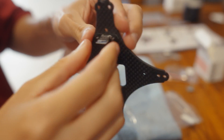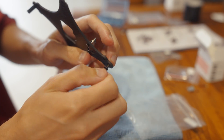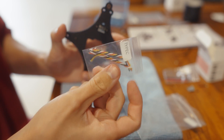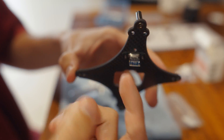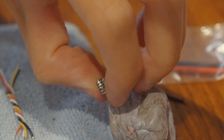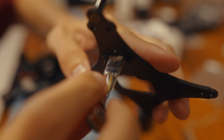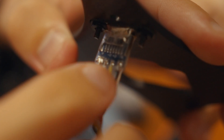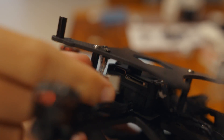Now the final plate - put that in this orientation with the two countersunk screws that way, and standoffs in. We'll solder this wire to this which will be plugged into the Avata. Swap the USB-C around so the orientation is that way with the pads facing up. The USB-C is done, soldered and heat-shrunk - it's basically just power to power: negative D to negative D, positive D to positive D, ground to ground. The same to each one. Cap it up, put the lid on this guy and now with this USB-C I can just plug that in.